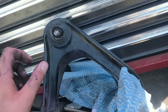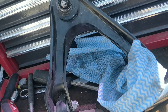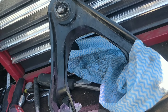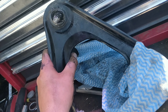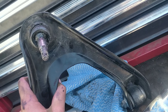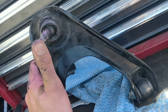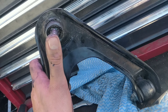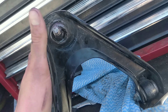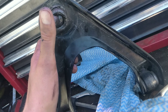I put the ball joint back in because my replacement ball joint doesn't press in properly. The diameter of the hole in the control arm is too big — it fits in there snug but it's not tight by any means. Pull it out and it'll just fall out moving the thing around. It needs more pressure than that. So now I'm going to have to order different, better control arms.